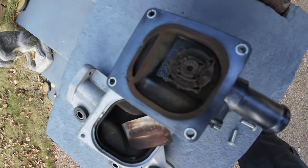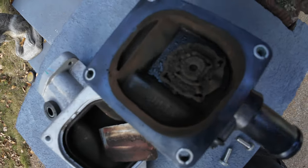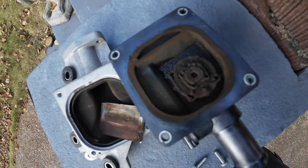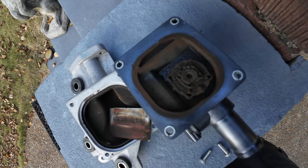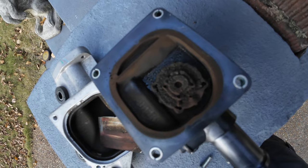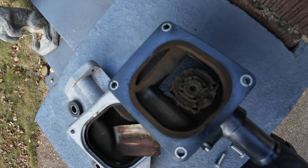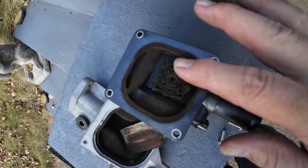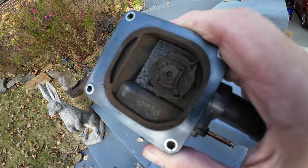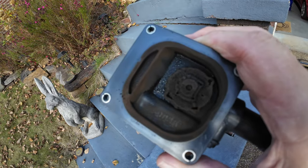It's a very bad design from Toyota. Those air pumps are located in the passenger side wheel well, and they get wet and allow water to come in if you're driving in the rain, or if, you know, they're exposed to water. So eventually these things rust and that valve destroys itself. So hopefully we got something good going now.